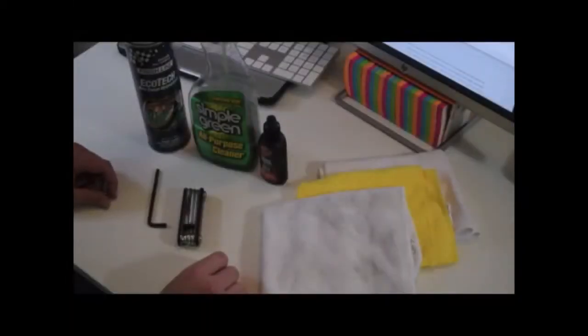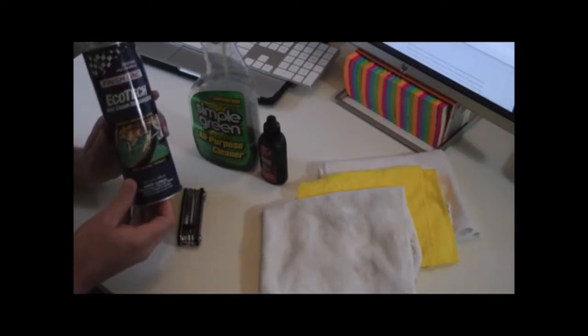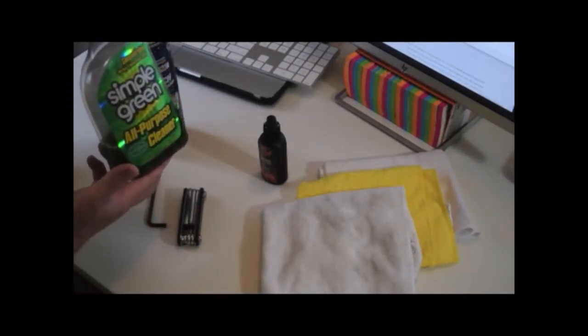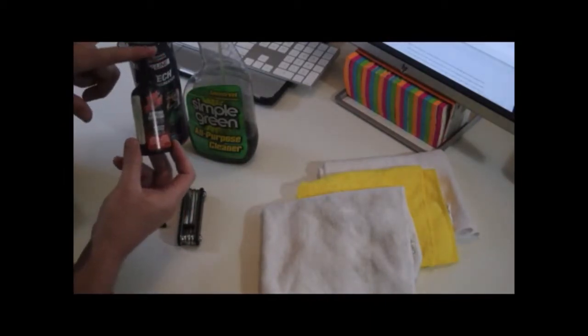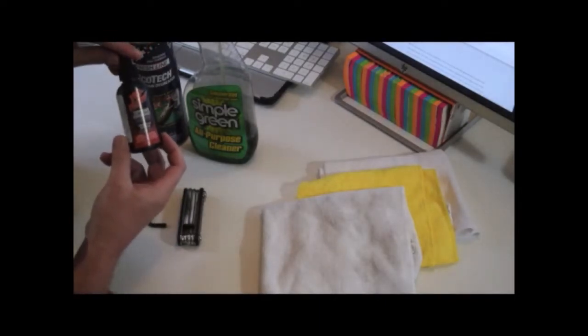You want to do it probably at least once a week if you ride a lot. We're going to need a handful of things to properly clean and lube our chains. First we're going to need a degreaser — this one is specifically for bikes. But if you don't have a fancy bike-shop degreaser, Simple Green will work just fine on your chain and gears. After degreasing, we need to lube it up again. This unfortunately has no substitute — don't use household oils. Go to your local bike shop. Tri-Flow is fantastic, only about five bucks and it'll last a really long time.